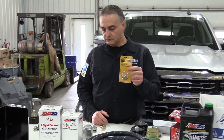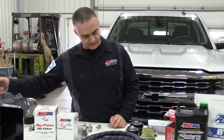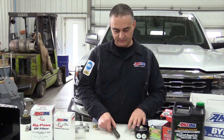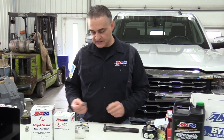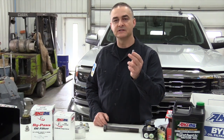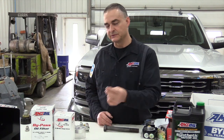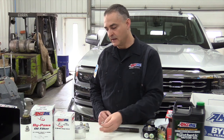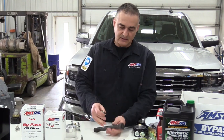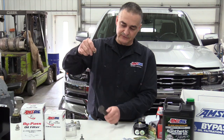I also have the Gold Plug magnetic plugs — I'm a dealer for Gold Plugs. This particular plug right here is the one that replaces the engine oil plug on this 5.3. This is the standard plug for that engine and there's no magnet on it at all. The magnet gives you a way to monitor if there's something going on inside that engine as far as big particles. The oil analysis will show you the small particles; the magnet or a cut filter will show you the big particles. The Gold Plug replacement uses a neodymium magnet, which is a very strong magnet. If there's anything floating around in that oil, that magnet's going to pick it up.